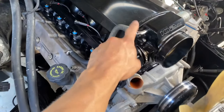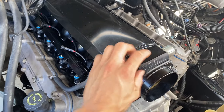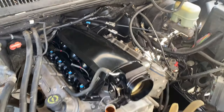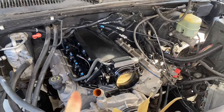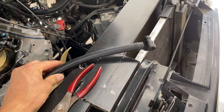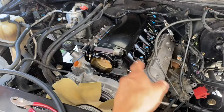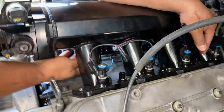Now we're trying to figure out the whole hose routing situation. This crankcase vent right here - originally it was facing this way, but if you're using this manifold it should just turn 180 degrees no problem. This hose right here we got is about two feet long - it's going to be for the brake booster, long enough to reach the intake manifold. Route that through there, and we have our plugs here underneath.